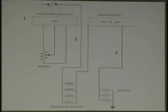You know those lousy injectors, right? If you went out there and you pulled a couple off, all of a sudden the car started up and ran on fewer cylinders, but it started up because you probably pulled off one of them that was shorted. It was sensing that and not allowing the injectors to spray fuel in. A lot of times people go out there with a Noid light and say, hey, I got no injector pulse. Well, maybe the computer has shut it down.